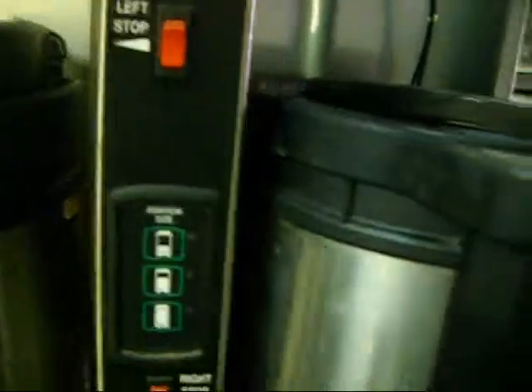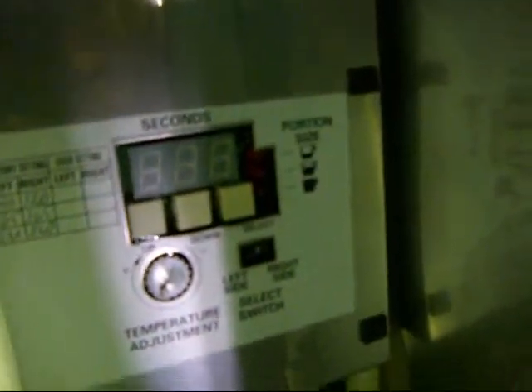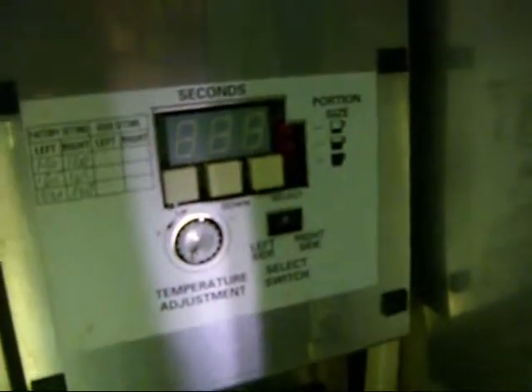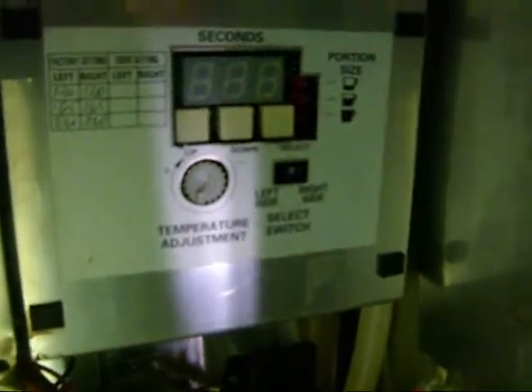I did start this a while ago — I filled it up and ran it a couple times to make sure everything's okay, to check amperage and make sure everything's perfect. When you first fill this, it has a safety feature so that if, say, at night the line would break or something would happen and it would start to overflow, it's only going to run for five minutes and shut down. That's what it's supposed to do. So on the original fill, you have to plug it in, take the whole panel off, and it will fill most of the way up. Some models do this, some don't — this one did for me. It's all in the book, which I have right here.